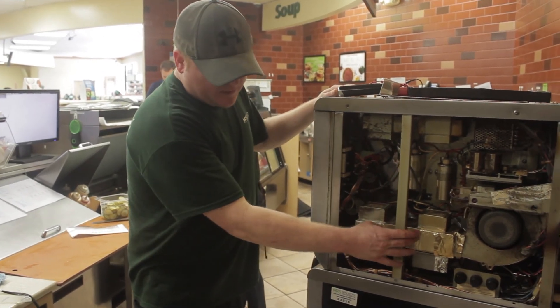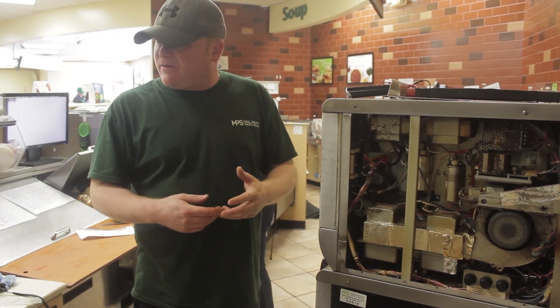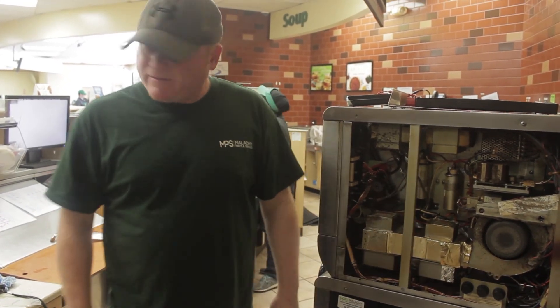Now you have a problem with your microwave system. That's why you're getting those F3s. After a while they start amping up real slow and it'll give you that error. I'll replace that for you too.